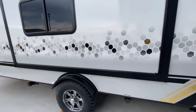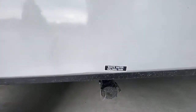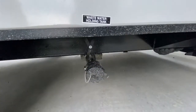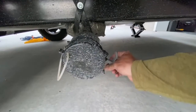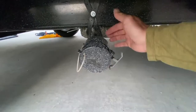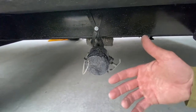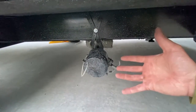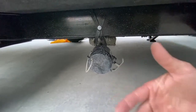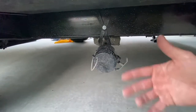Now go to the other side of the trailer. There are two spots for your gray and black water. The waste water holding tank is your gray water — you pull it away from the pipe and that opens the valve allowing the gray water to flow. This gray water is your kitchen water and bathroom faucet water. Typically you could release this at your site if they allow it, just so you don't have to carry the weight. No problem with this.